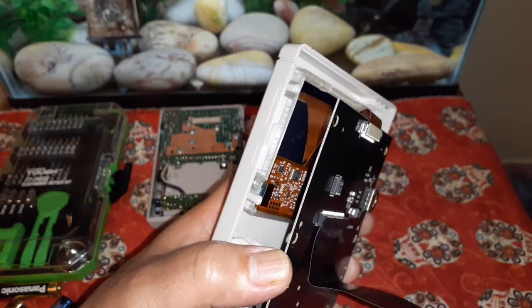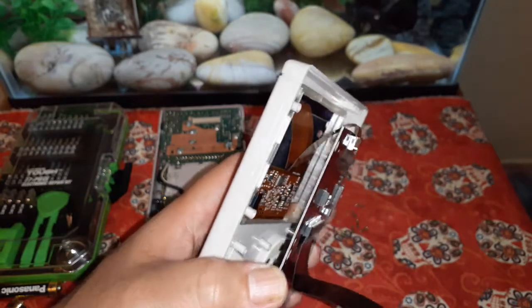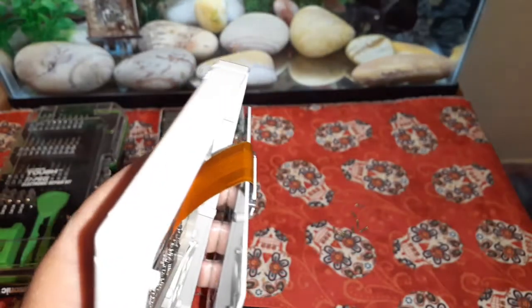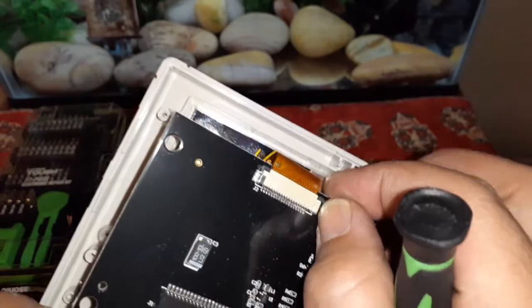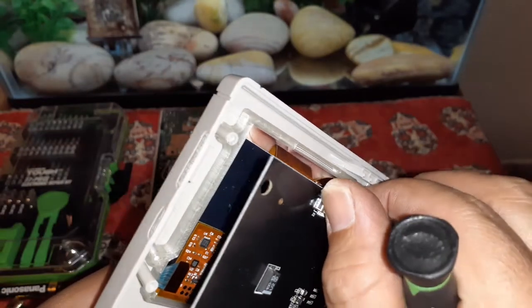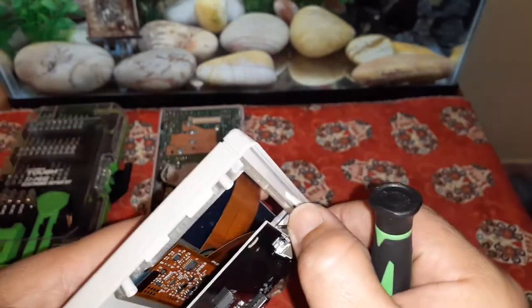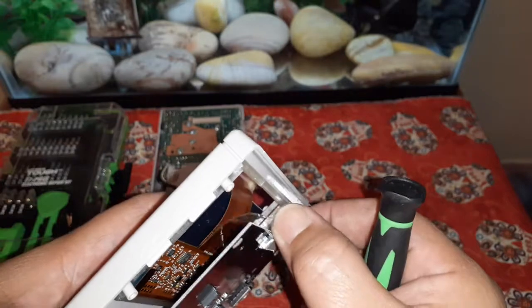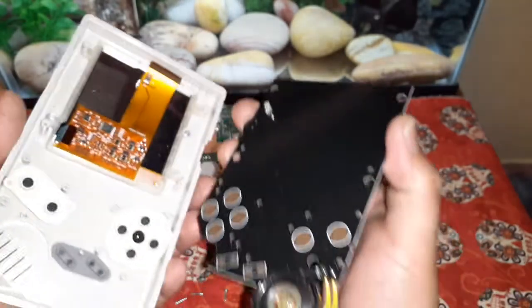And that was a little hard to do because it just didn't want to line up like they show on the videos where they make it look like it was so simple. But the ribbon only snaps in right here, just like that. It pushes up. Okay, it locks with these locks, and then it pulls out. Pull straight up, just like that, and the board comes off.